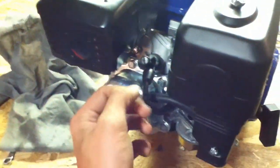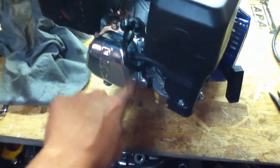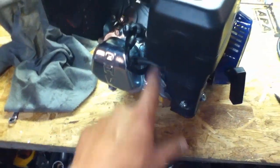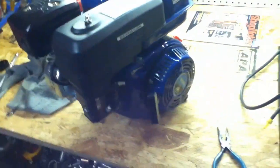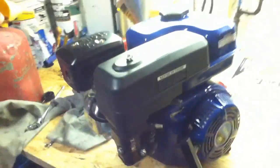The PCV tube is an important thing. If you don't have that, when the piston comes up and down it forces quite a bit of air, and it stops it from pushing the seals out — it just stoves that air into the air cleaner. Some motors like Briggs and Stratton just have a tube going down, but I think that's actually good for induction a little bit — it's kind of a forced induction, if you will. Let's get her down on the rubber mat and give her a run. I don't want to run it up here because it's a three-foot drop to concrete, and also you're not supposed to run these on hard surfaces because it can crack the casing.